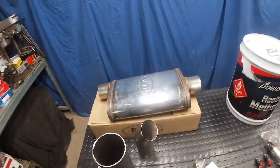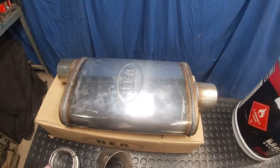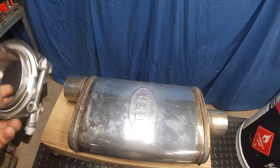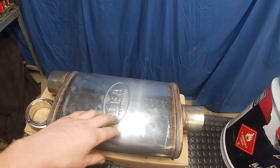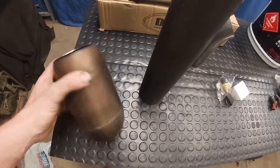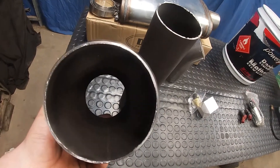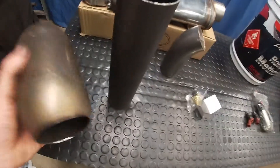Okay, so before it starts smoking I did get some more goodies for this thing. Got another muffler for it to try and quiet it down. I was going to make a pipe to go over the diff — got a V-band so I can make another section, have it go over the diff and have this muffler at the back with a 45-degree going down. As well as that, I got a fake cat to put on it, because where I live having no cat is a big fine, so I'm making up a fake cat to put on it.